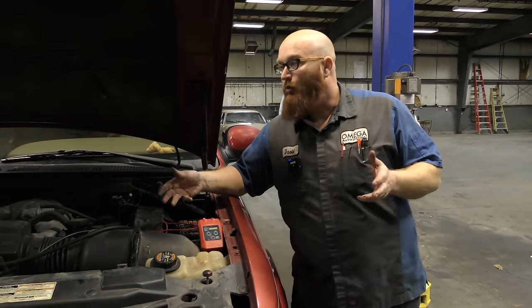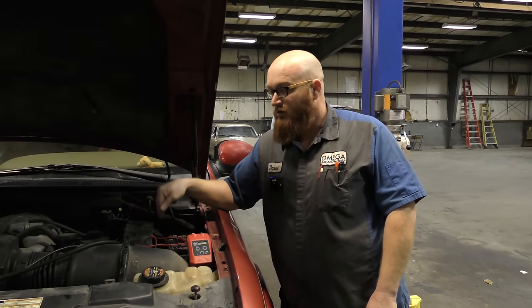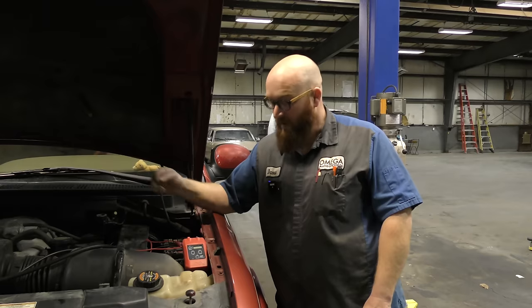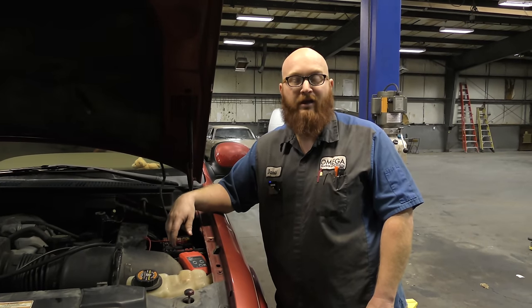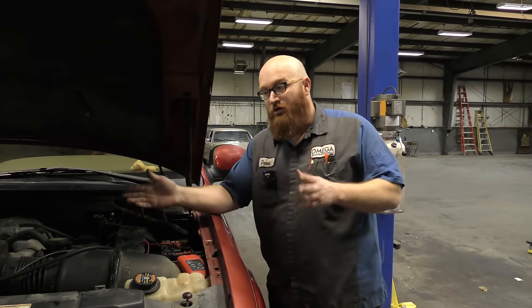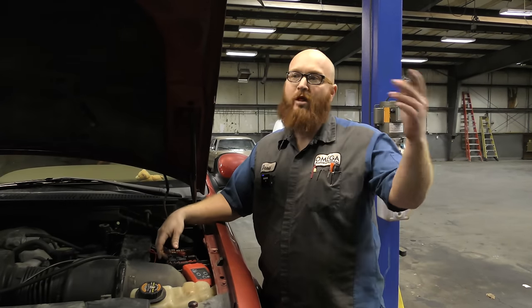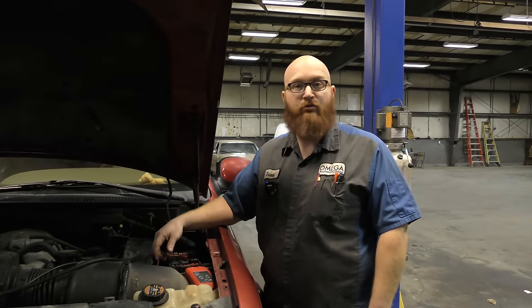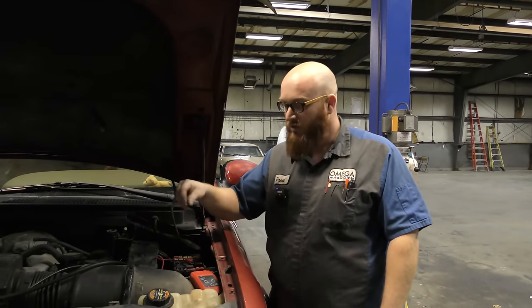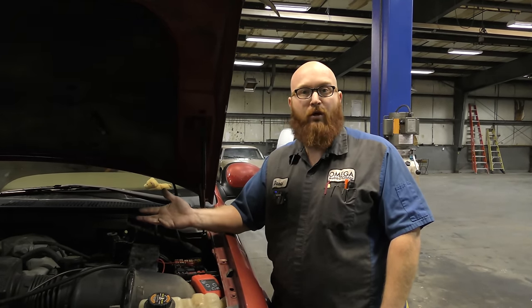I've actually had this scenario before where someone pays me $100. I'm not going to do this for $20 — this is a job that, without this tool, could be a $300 or $400 diagnosis. It can take hours to find this. I'm going to charge probably $100 to use this tool on your car. I charged a guy $100 to find out that the little light bulb in his trunk was never turning off. That's all it was. He said, I could have checked that. Well, yeah, you could have, but you didn't — you asked me to find it. I went through every single circuit, did this whole test, found it on that fuse, unplugged that bulb, and the draw went away.